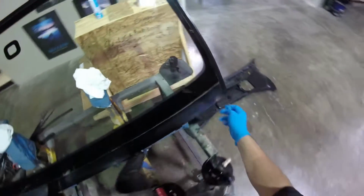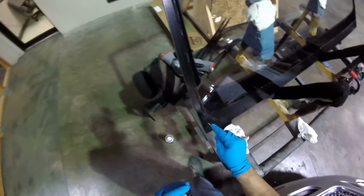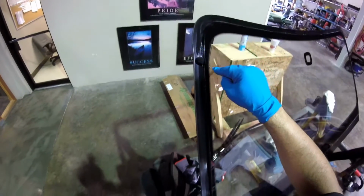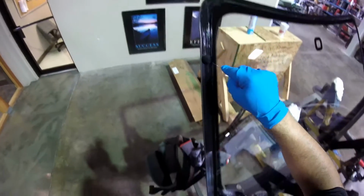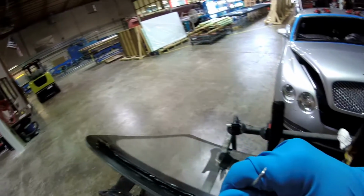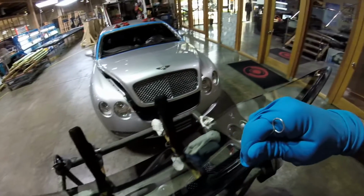I'm gonna go inside because I don't want to have it exposed too much outside this time. And I'm gonna seal the edge, because if I don't seal it, the bubbles are gonna open. When you seal it with this primer, you can seal the little lamination. Like that, and I'll just do the edge. You see the primer fills it and seals the plastic.